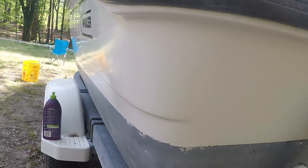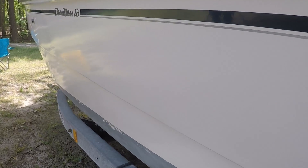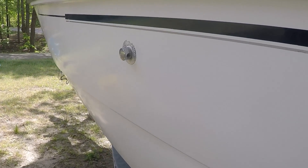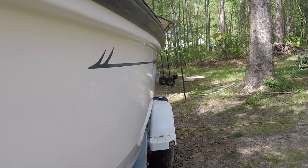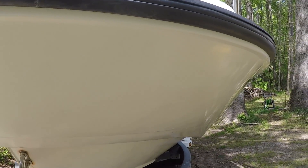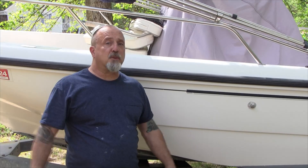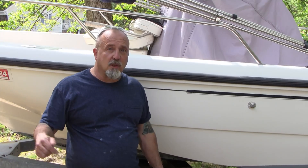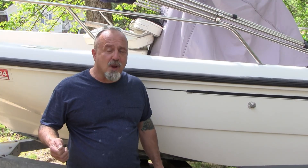Here's looking up the side of the boat and you can see it's got a pretty good shine going on now. This is after the wet sanding with the 800-grit gray pad, 1000-grit white pad, and then subsequently the medium compound and the wax. I'm pretty happy with the way it's come out. If you need any of the products used in this video, check the description for links. If you like the video, hit share and like, and don't forget to subscribe — thanks for watching.